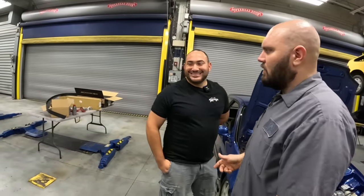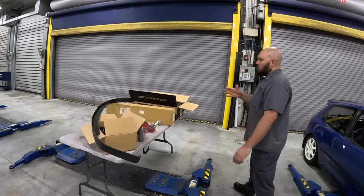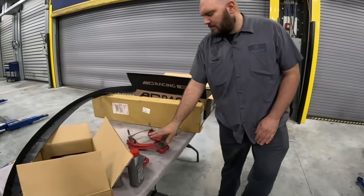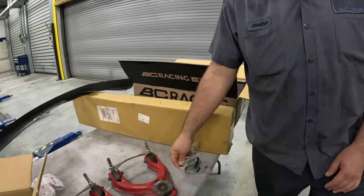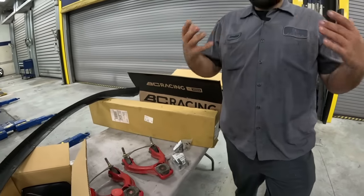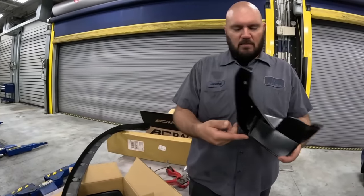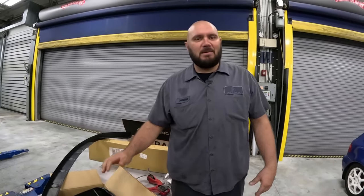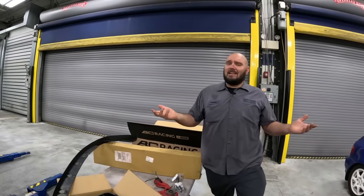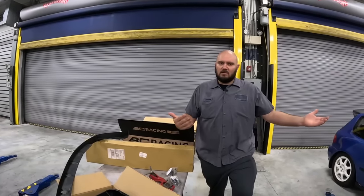And then we also are swapping out the control arms so we have a little bit more clearance with the Skunk2 ones. They're old arms, but we bought new Pro Series ball joints for it. So we're going to swap these out, adjust everything, install everything, maybe put these things on there. They won't last long. They'll get worn down, I'm sure about that. But this is our prep. This isn't a DIY. We're going to show you us just getting it done. So follow along and tell us what you think.